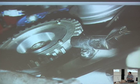These wheels come in a number of different styles — typically known as a 4-1 or 12-1 type of sensor, ranging anywhere from four teeth minus one up to about 60 teeth minus two. Obviously the more teeth you have, the more accurately you can know where the engine is in its cycle. A 36-minus-one tooth wheel will give you 10 degrees of fixed accuracy; between those teeth you're estimating where you are. A 36-minus-one wheel is very common on Ford engines — very hacker-friendly once you have access to the sensor.